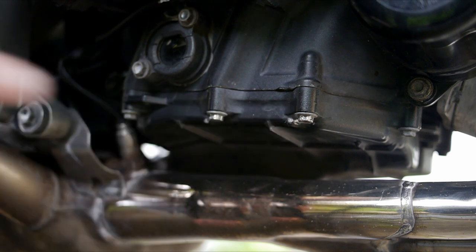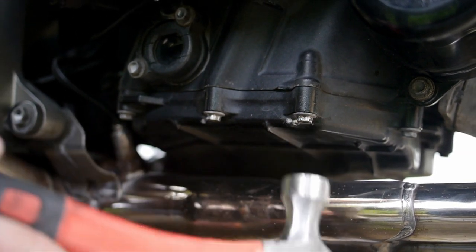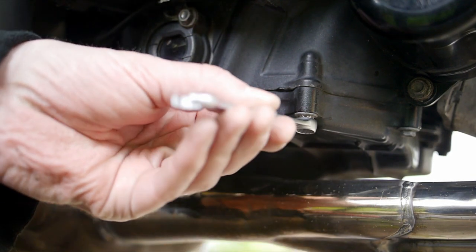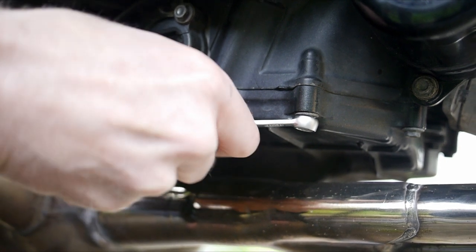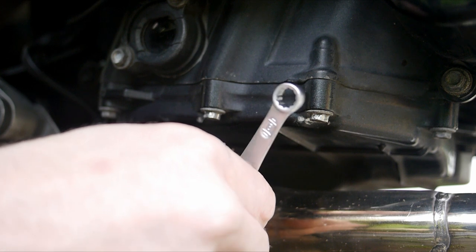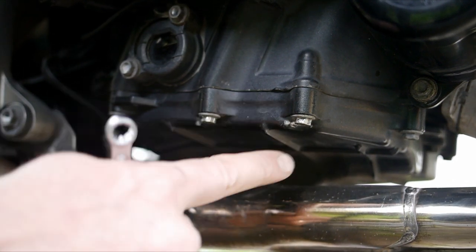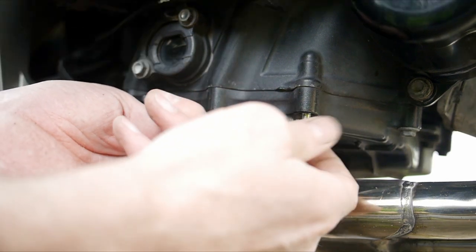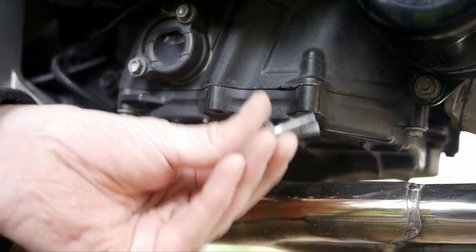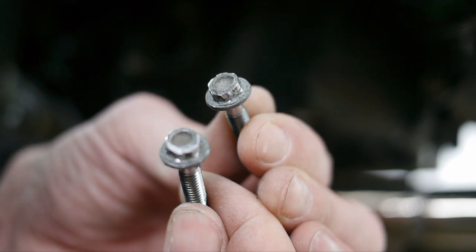So what I did was I got aggressive on these. First of all, I ran the engine, warmed the bike up, and then I bashed them with a hammer to get the edges all out of shape - to squash the head of the bolt down on both of those. Then I took my shiny new spanner, hammered that onto the horrible gnarly shaped bolt, and lo and behold, it actually worked and they came off. And another sign of a good quality tool - no damage whatsoever inside the Wera spanner. I'm going to treat myself to a full set of these because I can't keep doing stuff like this with cheap nasty crap tools. Well done Honda - do something about the quality of your paintwork and your nuts and bolts.